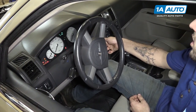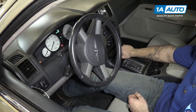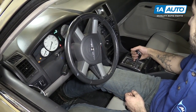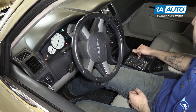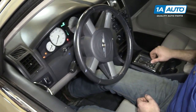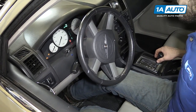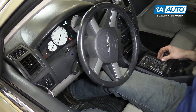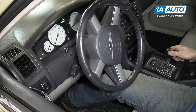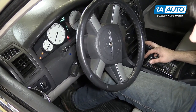Start your vehicle. Keep your foot pressed firmly on the brake and cycle through each gear in the transmission for a few seconds. If you have a manual shifter like us, click up as high as it will allow you and sit in each gear for a few seconds. Cycle back through, and check your fluid level with the vehicle in park.